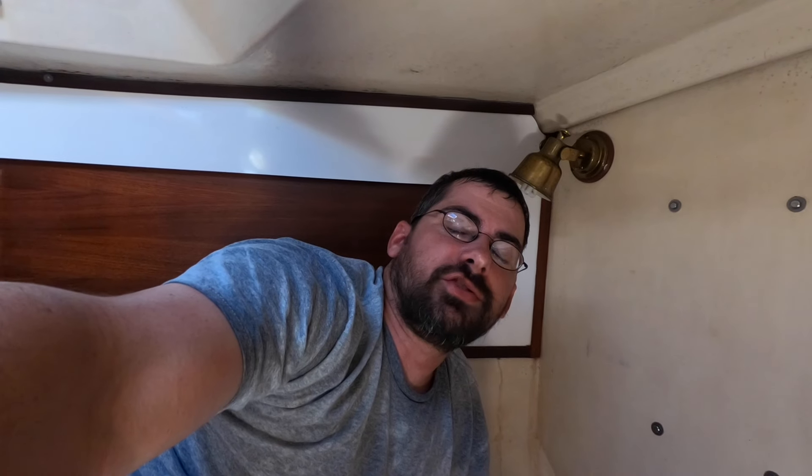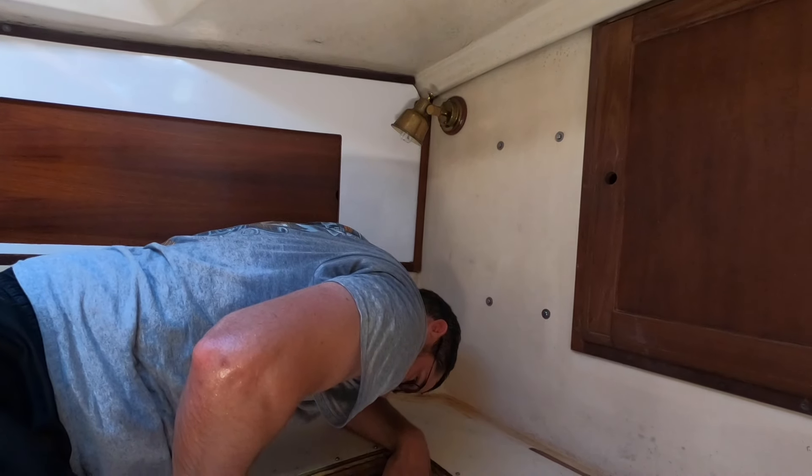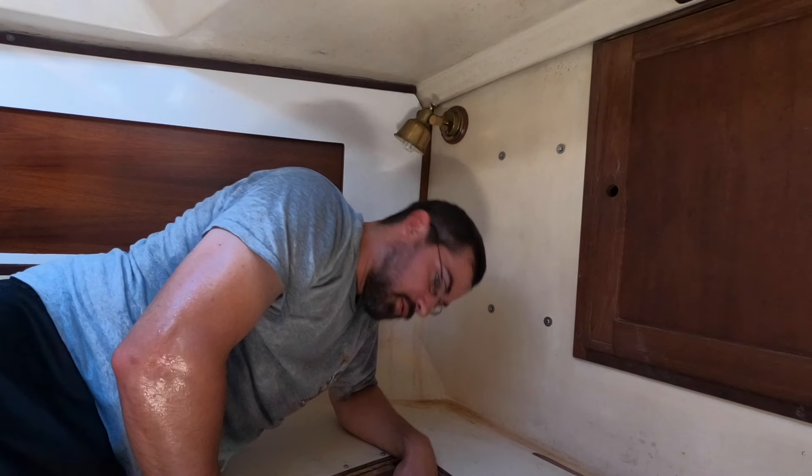What I'm having to do is drop the rudder. Right now we've got it strapped up with some two-inch ratchet straps so that when I do take it apart it doesn't fall on the ground - takes a little tension off as I'm starting to loosen all the bolts. You will see some corrosion - we're going to tackle that once we drop the rudder. Once we get the cables loose, I'm going to take a permanent marker and mark the bolts that tension the cable so I get it back properly. I've never done this before, so we'll learn together.